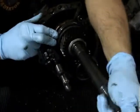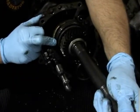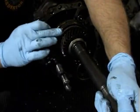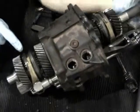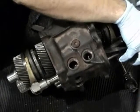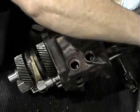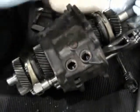So you don't shift the gears — you're engaging the gears with a collar. These are the synchronizer rings, the updated ones, and these are the little friction surfaces that allow you to shift smoothly. When these wear, that's what makes your car crunch. Here's fifth and sixth gear at the rear of the transmission. I'm turning it — it helps to engage it. I grab a gear, then I'll go the other way. And that's the engagement for fifth and sixth gear. That's how it works.